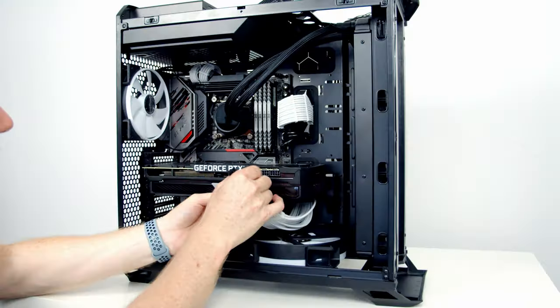only to realise that the ARGB lighting bar at the front wasn't lighting up anymore. Opened the back of the case and it had come loose. So this is a very common problem when daisy chaining ARGB connectors. It's not unique to this case or these particular fans.